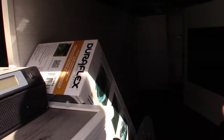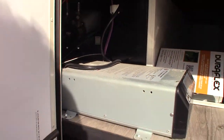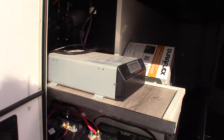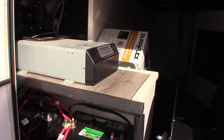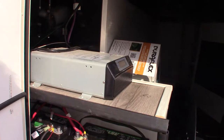We've got a hose reel obviously, and this is a dump hose. This is a power inverter. Inverters — if you don't know, I'll just assume you don't so I don't leave anybody out — inverters convert 12-volt DC into 110 AC.